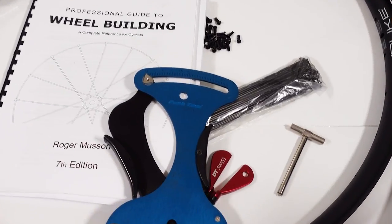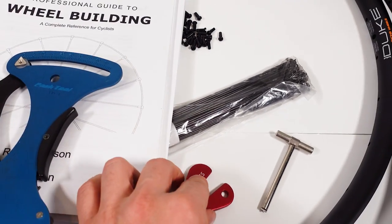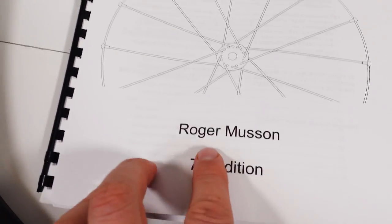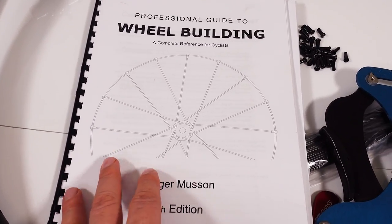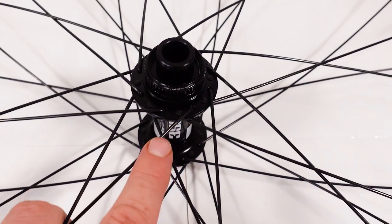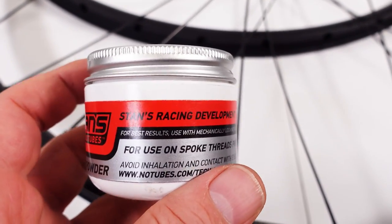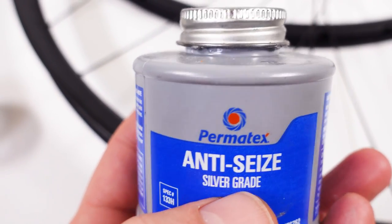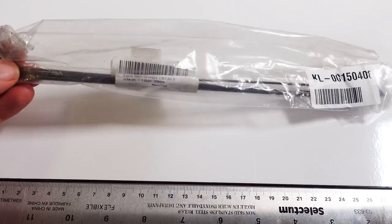I kind of promised to show how to build a wheel from scratch and I might do it one day. But in this video: if you have a TM1 tension meter, a good spoke wrench, and maybe a nipple driver, you're good to go. I'd highly recommend Roger Musson's wheel building book — everything you need is in there. I laced this front wheel 3-cross — over, over, under. I prepped the spokes for the first time with Teflon powder made by Stance. Other times I've used oil or silver anti-seize. Prep the spokes with something, especially if you're using aluminum nipples.